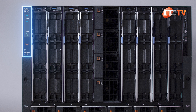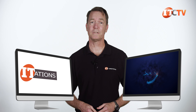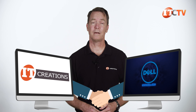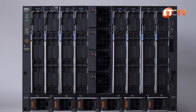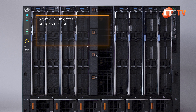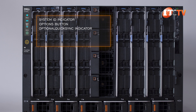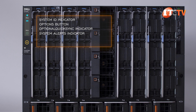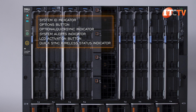NV DIMMs will reduce the number of available bays because of the additional battery required to protect the DIMMs during a power loss. Lastly, there's a single-width MX5016S storage module supporting up to 16 hot-swap 2.5-inch SAS drives. You can install one to seven MX5016S storage modules for up to 112 drives, but you will need at least one of the compute modules. Serve the Home and Storage Review also have done reviews on this system, and I've added a few links below.